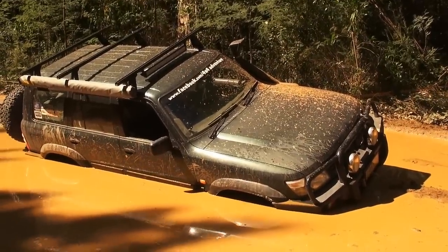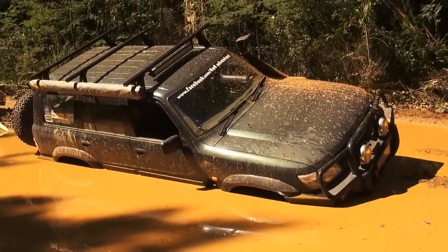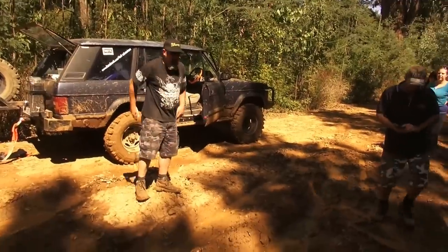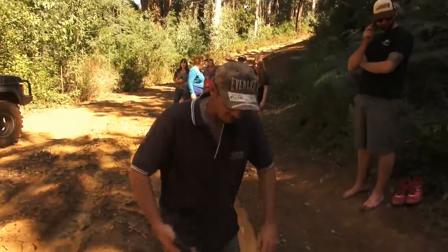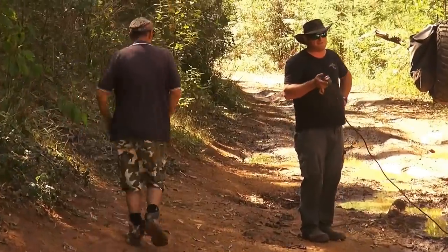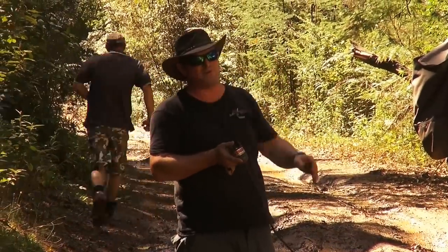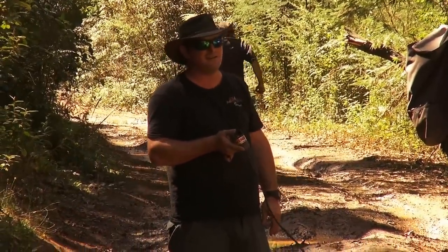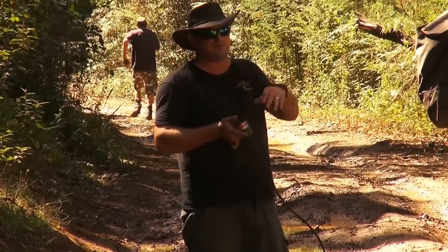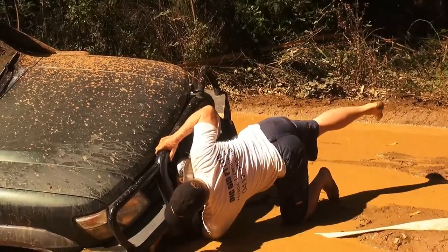Are you around a big tree? Yeah, now I'm going in. I need another car to anchor me from the back. Who's next? Me. You're going in, eh? Well, I reckon once he's straight and maybe put on a strap in there, and very slowly what we'll do is I'll keep the tension on the winch. Yep. We'll drag him forward. Yeah, because if that comes around the angle, we'll keep it up. We'll just gotta keep the power on the winch. But yeah, nothing too quick, just nice and slow. Up to the hook.